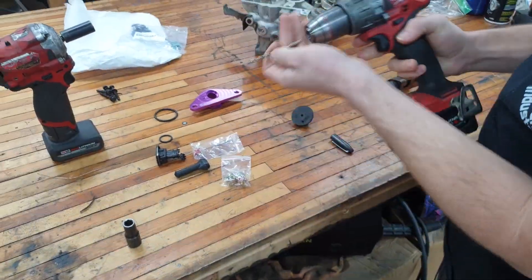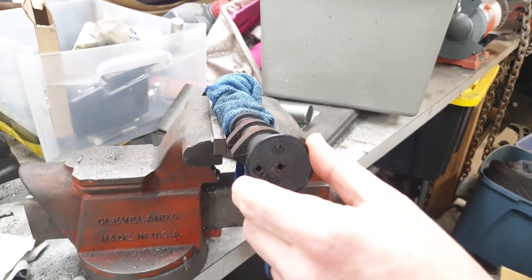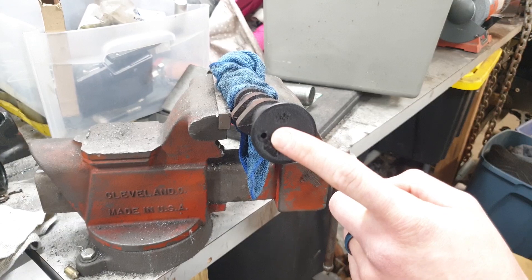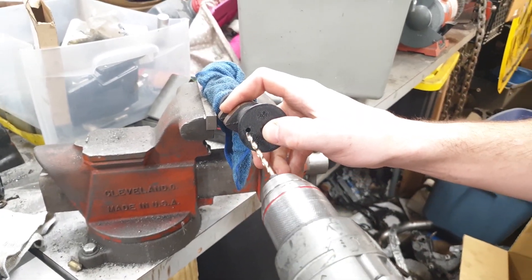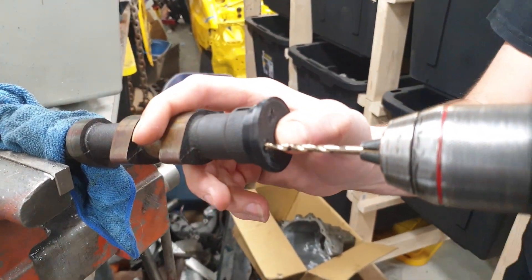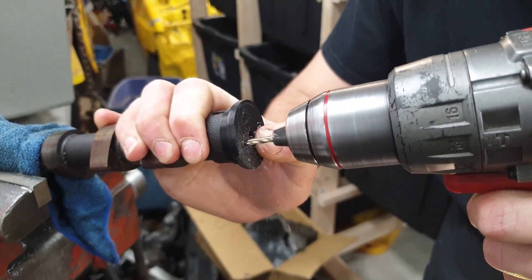Go ahead and chuck that up in the drill. We went ahead and got our camshaft chucked up in the vise with a rag to protect our machine surfaces. We line the drill guide up - I would not drill this in the head. You could put this in the cylinder head and drill it there if you wanted to, but you're going to get little iron shavings inside your cylinder head and you're going to have a bad time. Now we have our mark, our drill guide is in place. This should help you keep your drill bit nice and straight. Drill until your mark meets up with the edge of the print. This is pretty soft steel, so this shouldn't be hard, especially with the included cobalt drill bits.